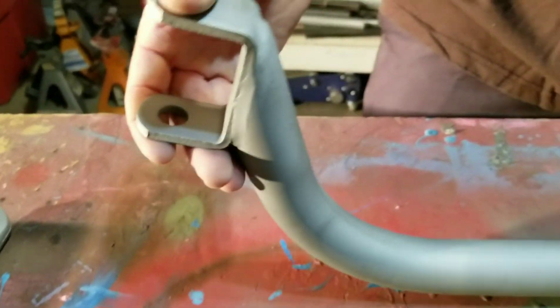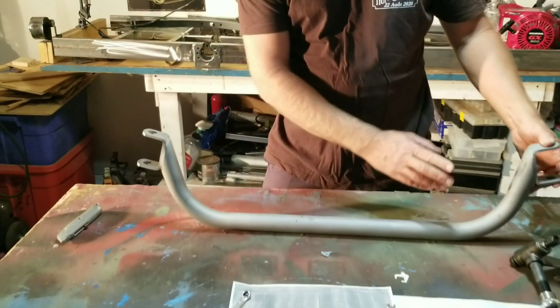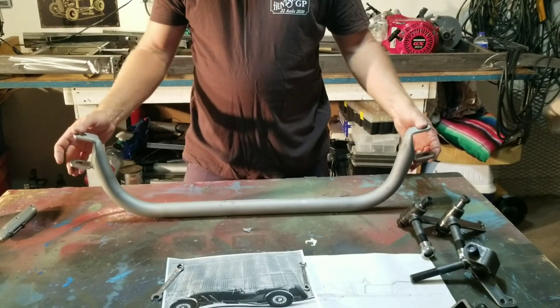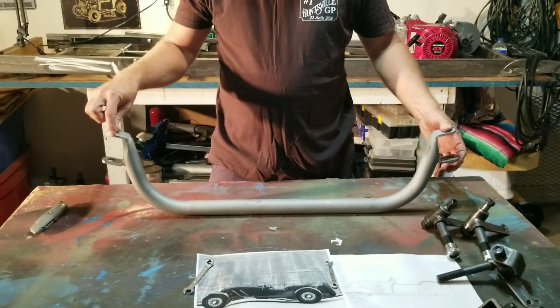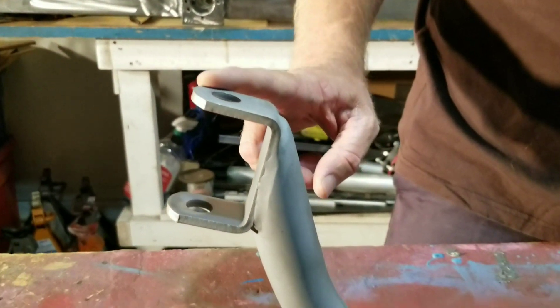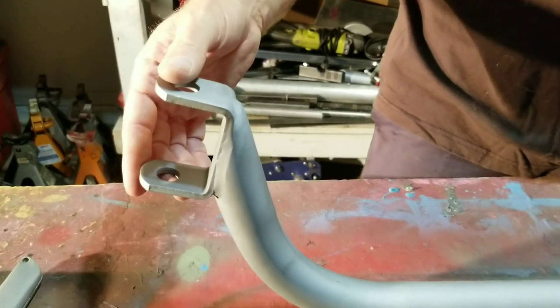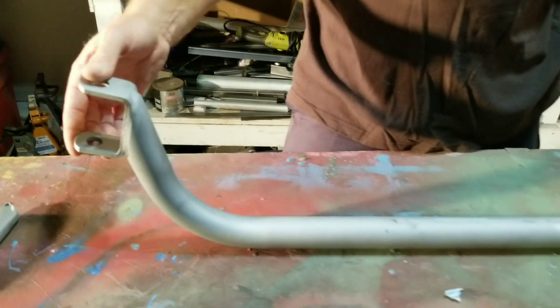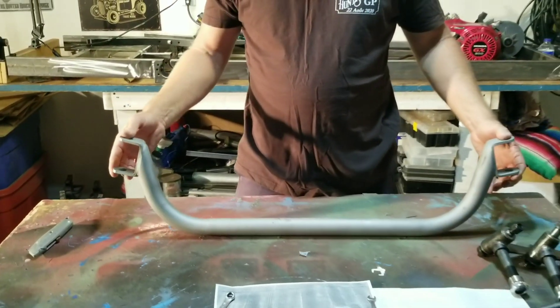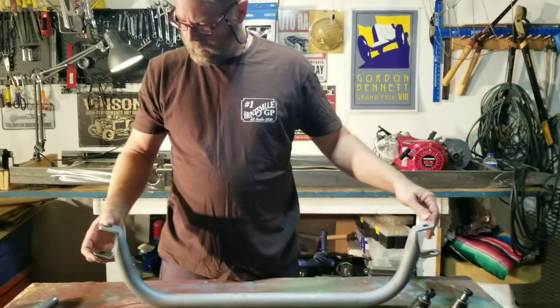This already has the kingpin inclination welded onto the drop axle. This is my drop axle design that I copied from Dennis Thomas - full disclosure. Cycle carters copy whatever works for other people; Dennis Thomas probably copied it off somebody else. This drop axle layout is pretty standard among cyclocars. This is the Azusa style spindle attachment - where we all started off using these go-kart spindles. But these have 14 degrees of kingpin inclination, tilted back 14 degrees. This mimics what I did on my Model T and my dad's Duesenberg and should work out great.